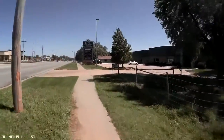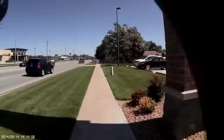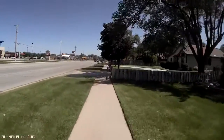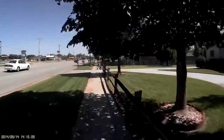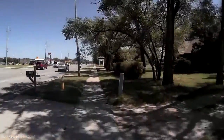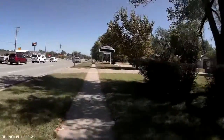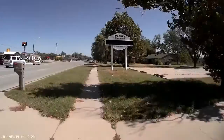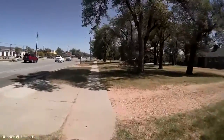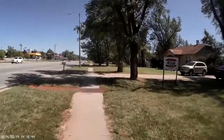But that gives you an idea of what it's like for me with the existing clutch. You know, it's great. Works great, I dig it. But it is the weak link. So I'm sure there's a lot of guys out there that use these BMC hub motors that have had the clutch mechanism fail and start spinning out like I did. And so they've got a lot of those assemblies just laying around. And that's something they can do with it. They can weld them up and make that BMC hub motor a little more bulletproof, so to speak. A little more reliable. Fewer moving parts. Fewer things to fail.